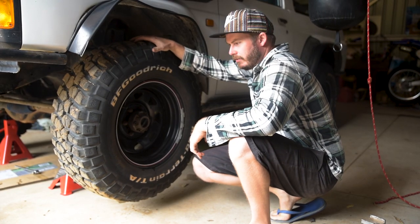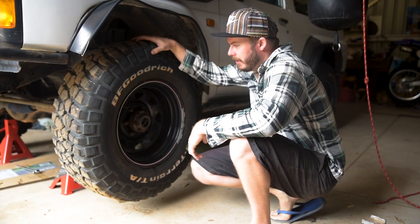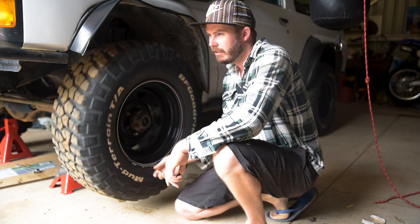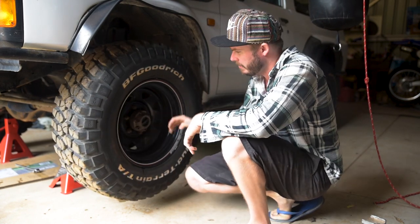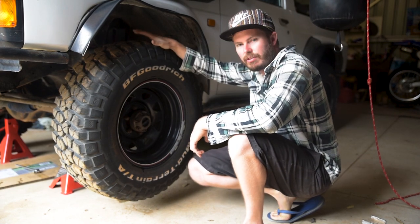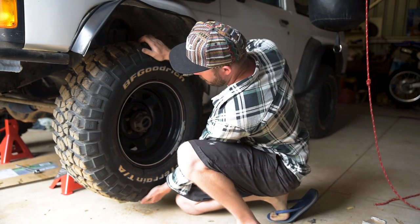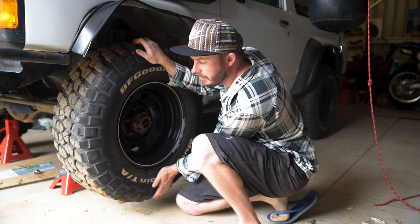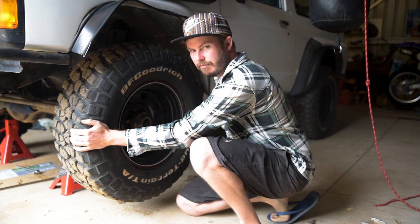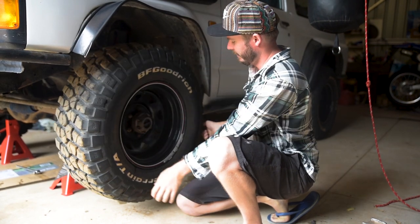While we've got the front axle off the ground, we're going to have a look at the front wheel bearings — probably want to do this for the back as well. All we're going to do is give it a spin and listen for any horrible grinding sounds. There's a bit of a noise there, but that's probably just the brake pad touching the brake a little. There are two other points to check for wheel bearing play: top and bottom — pull it in and out. That's perfect, there's no play there. Then put your hands on the sides and jiggle it to feel for play in the steering — it's all perfect. Good news, Taylor, something is right with your car!